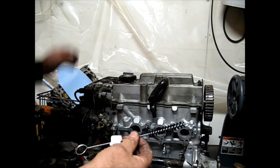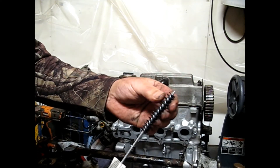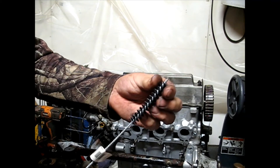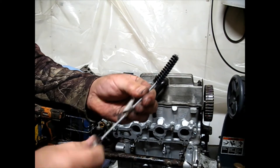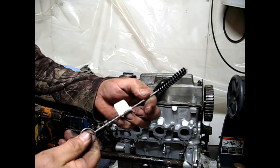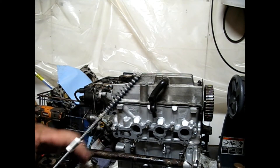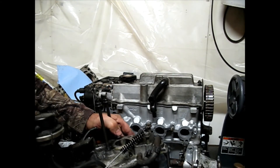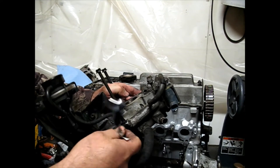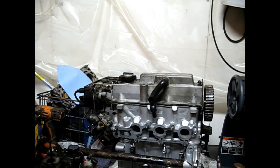It's a brush — more flexible than a coat hanger — and it's got built-in spirals which I think are going to be what I need. When it catches on something I'll be able to turn it and get it all the way up into the passage. The carburetor ones I had were working but far too short. This one will be plenty long, even with the curve, to get in that hole and all the way to the bottom.